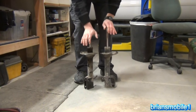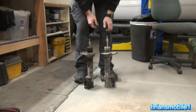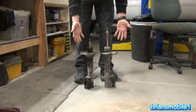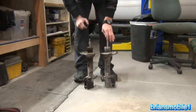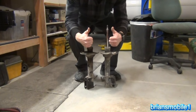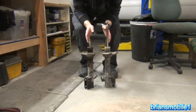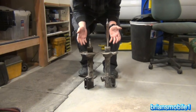Here I go to push them down, I'm putting the same pressure on the two of them. You see this one rebounds and starts coming back on its own — that's the difference between having a charge and not. This one's worn out because it's not rebounding as fast as it should and it doesn't go up all the way. It's a darn good thing that we're replacing these struts. You always want to replace them as a pair just so that you have a nice even performance — this will help with tire wear, especially on something all-wheel drive like a Subaru.